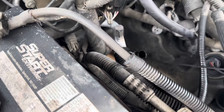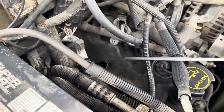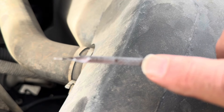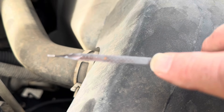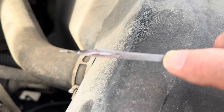This one right here we'll pull out carefully — this is the one that we'll actually see the level on. It's a little bit hard to see, but the transmission fluid's right up to right about here. This is the top of the crosshatch, so right here is what we're going for. Right now it looks to me like we're about a half a quart or so short.